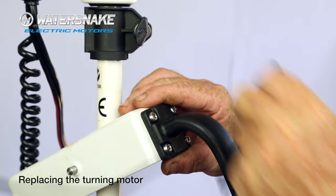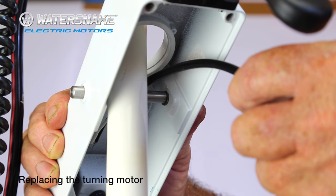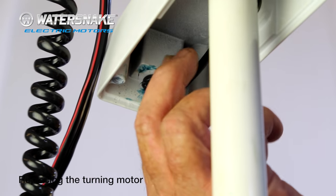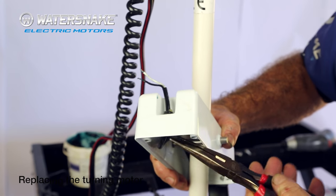Right, next, untie your top. Lower it down a little bit. The cable goes over the top of the stainless pin. Just grab it with your other hand and push it up through the holes. Push it up. Just keep lowering it as you're pushing it up. Just grab your pliers and start feeding them through until the black pops out the top.